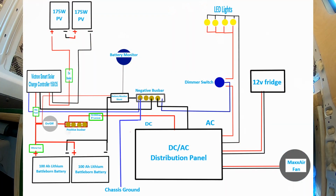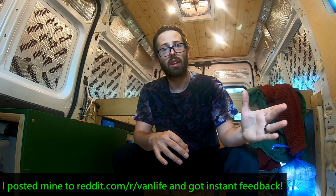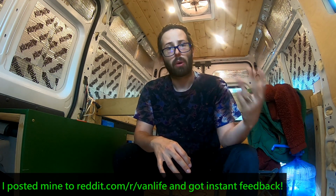You're gonna wanna create a wiring diagram. Write down exactly how everything is gonna be connected. And I recommend that you show that wiring diagram to people and get their advice. Go online to a VanLife group or post it on Instagram or just ask an electrician to look it over. Make sure that you've got the right wire sizes, the right fuses. There's built-in breakers and there's these bolt-on fuses. There's a couple different options.